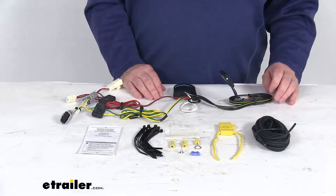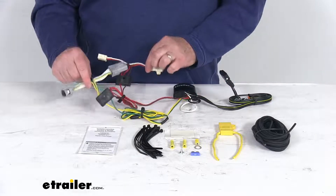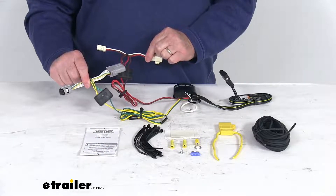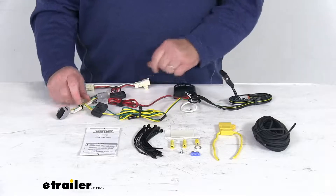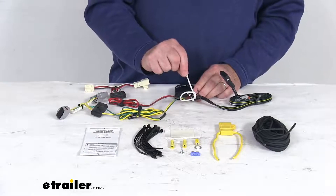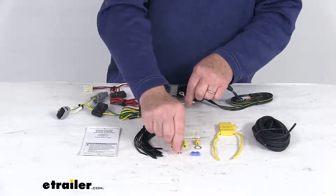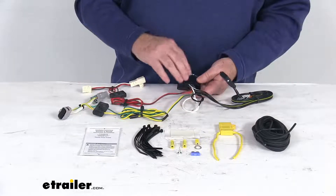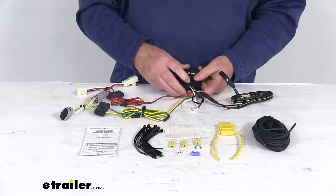To install it, go to the rear cargo area of the vehicle — the instructions will describe where the connection points are — and you'll find the connection points for these two T-connectors. Plug them in, and once they're all plugged in, you'll see your white wire with an eyelet on it; that needs to be connected to a good clean ground. If there's not one nearby, they include a ground screw so you can make your own ground. Run your four-way out the back. The ModuLite box has some weight to it, so you want to attach it to a flat surface so it doesn't bounce around.